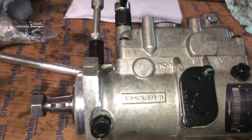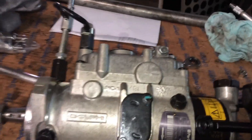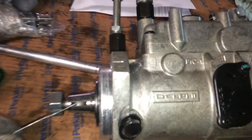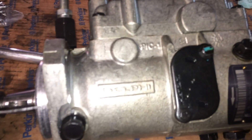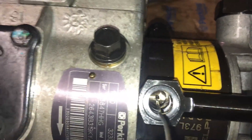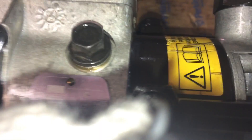First thing to do is set cylinder number one to top dead center. Right here in front there is a mark and it should be aligned with the pump name 'Delphi' — that's a very practical timing method. The most accurate timing is this tiny hole here; I'm using a tiny wire to probe the hole and try to reach the bottom part of it.